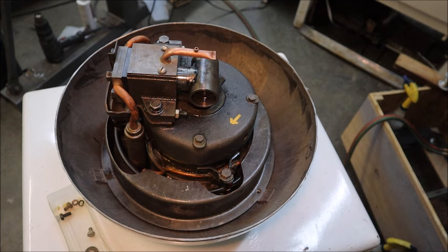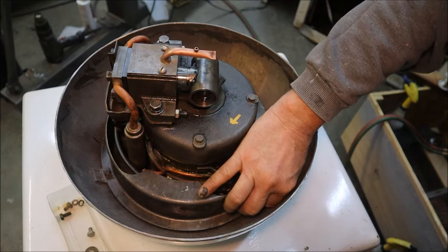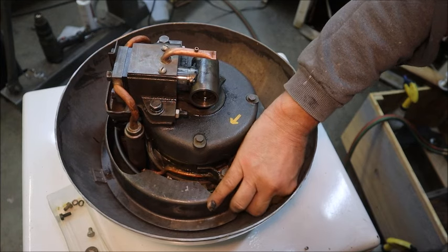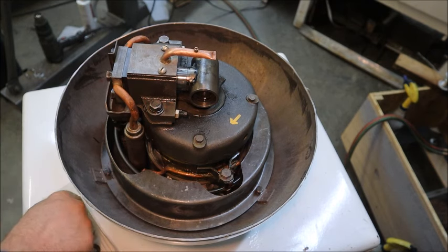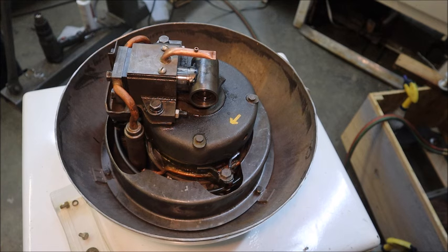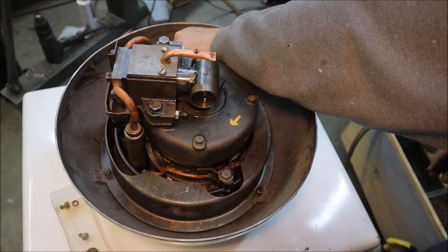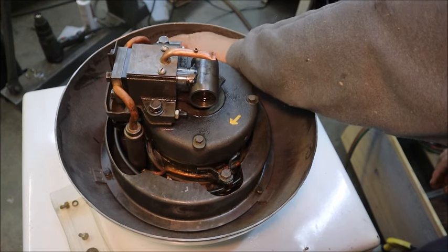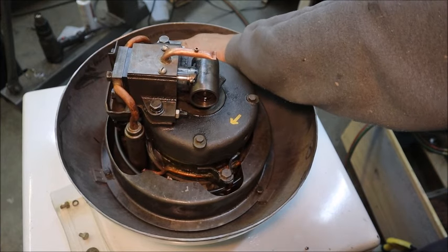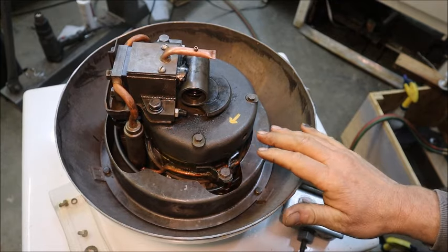The Monitor Top CK machines and the other scotch yoke machines such as the flat top GE don't have this piece inside because the compressor dome itself is that diameter - they have a bumper system that is allowed to bump against the compressor dome. But this unit with its big decorative round ball had to have this put in there to provide a stop for the compressor. This is a very unique design - there's nothing else like it.